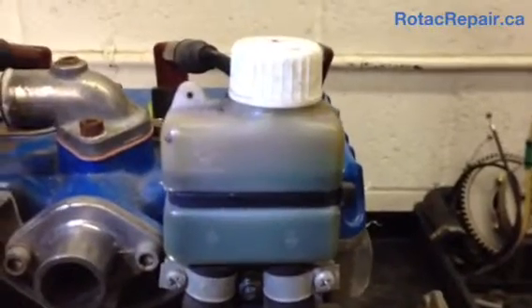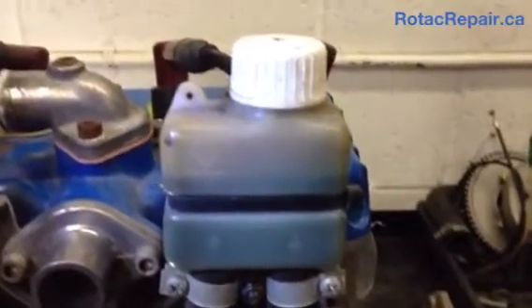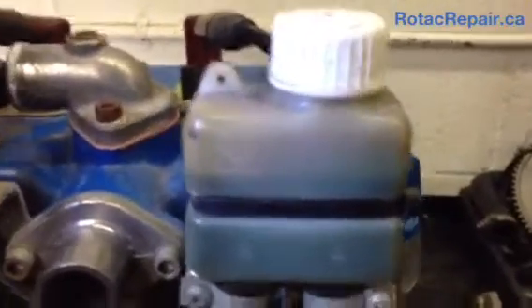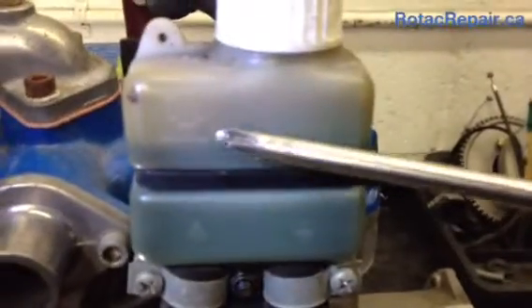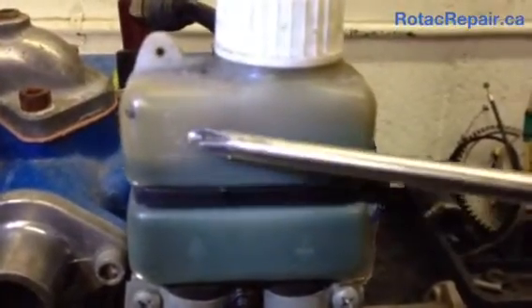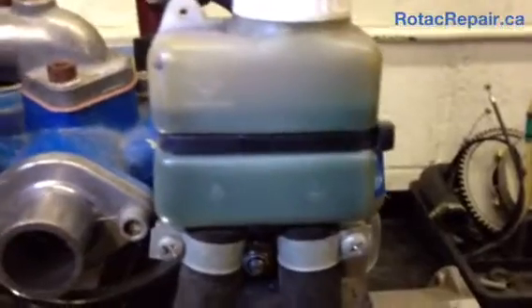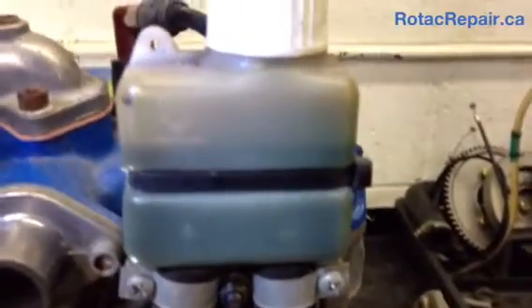Today I want to talk about your rotary valve oil. Here's the oil reservoir — we're looking at the level in it and you should be maintaining the level right up to where it's marked with a little arrow. We can see the oil across there, so we know the oil level is good. Now we've run it a hundred hours and we should be changing the oil at that point in time.